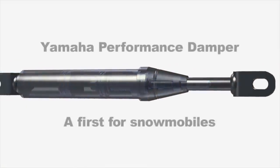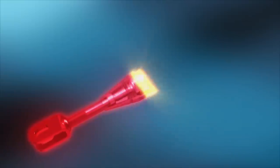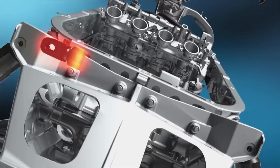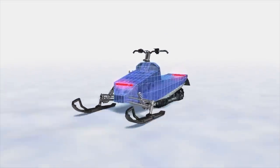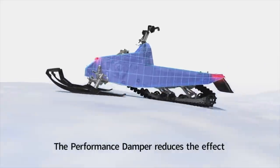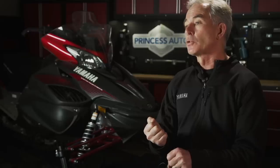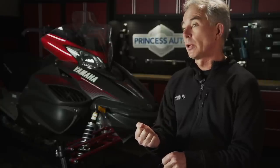The saturation point of the oil inside the damper is such that it can move very small amounts very quickly. If you apply wider-amplitude, slower-frequency inputs into the shock — as what would happen in suspension, hitting a bump and having a stroke — it moves much slower, to the point where a Performance Damper, if you were to compress it, moving maybe 20mm maximum, could take upwards of 24 hours to come back to its neutral state.